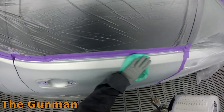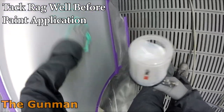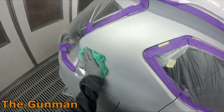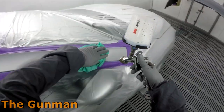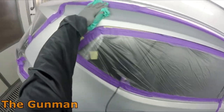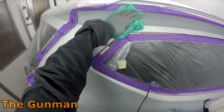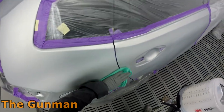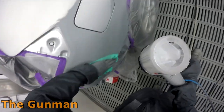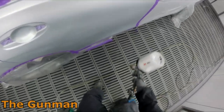I'm one of those people who learns better by stuffing it up myself. I actually had that happen on a rear bumper cover — got a few bits of fluff in it, missed them until I had the base coat down, then had to scuff them all out. I then sprayed the base coat a bit differently than recommended and it changed the color. I'd matched the color perfectly but because I sprayed it differently than the color card, it came out really dark. So get your panels as clean as possible before you put your base coat down.